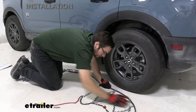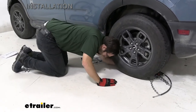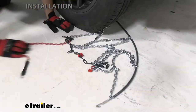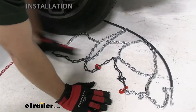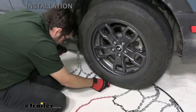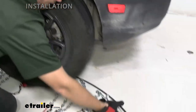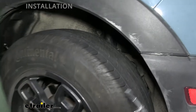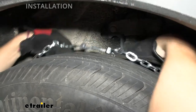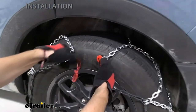Then simply slot it — take your chain, throw it around your tire, and find that center point where the natural break in the chain is. Bring your adjuster across, and fan out the chain a little to make sure it's seating properly. Now grab your two connectors and make the first connection, hooking in at the top. With the back connection made, seat the chain around the tire and make your front connection.